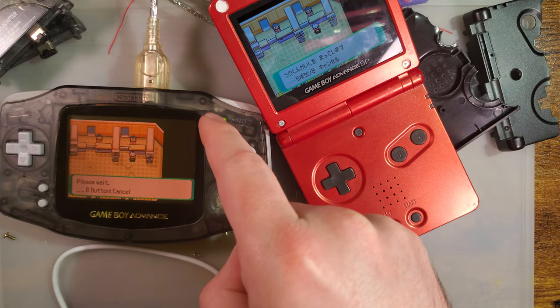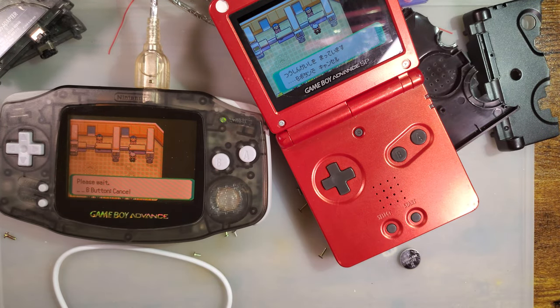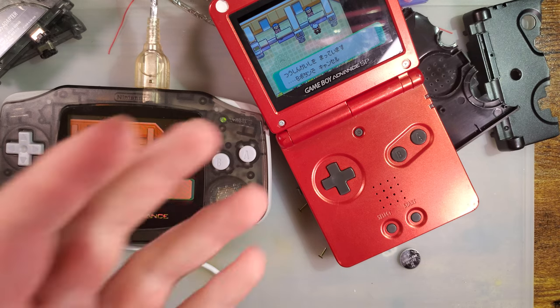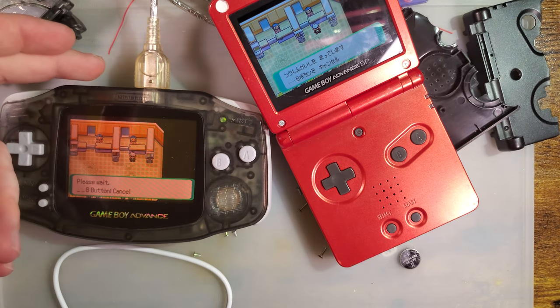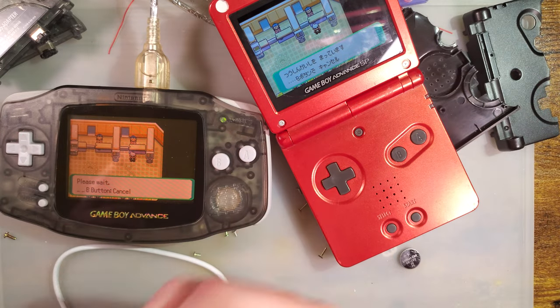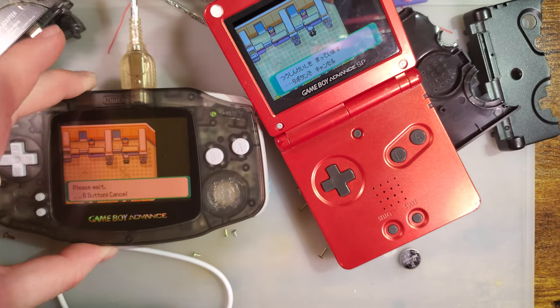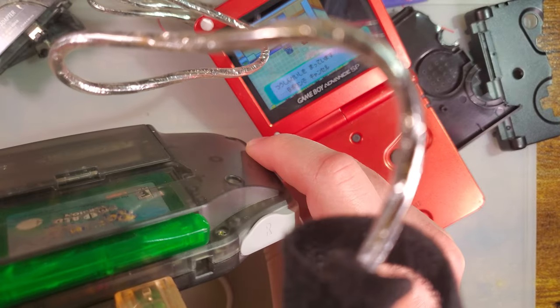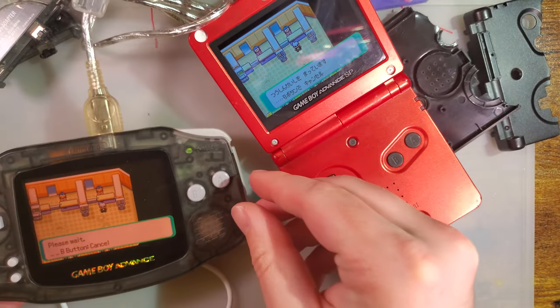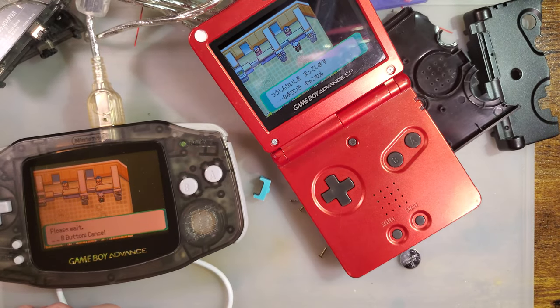If you want to wire this kit up like the new kit — which is again an identical kit just with a new cable — you can do exactly that. You've just got to modify your cable. There are also a couple of other options: you can wire in a switch, so TV Out only works when you have that switch enabled. Or you can get creative and wire up a microcontroller. Or you can wire it to something else entirely — carve out and put an RCA jack in your Game Boy Advance and just plug into an RCA jack on one of the shoulders or on the back.